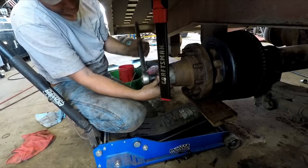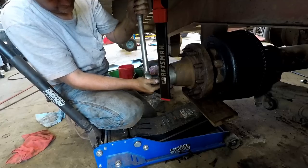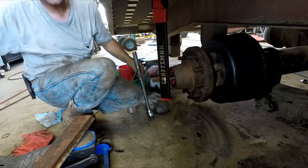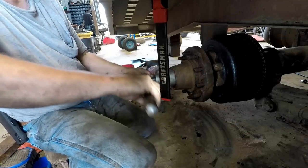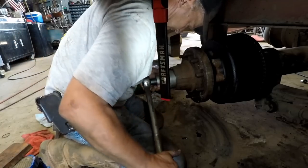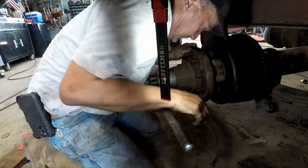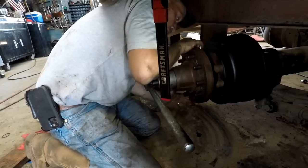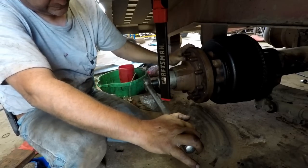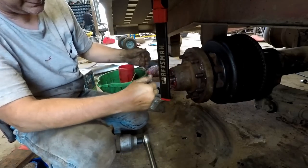This axle is going to get two new tires on it, so I don't have them mounted yet. I did some painting on my rims — they were pretty rusty, so I painted them up. What we do this tightening for is to seat the bearings so they turn really easy. I'm not going to put a torque wrench on this part — I'm just going to tighten it and make sure the bearings are seated and not moving.